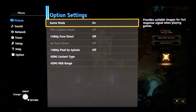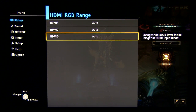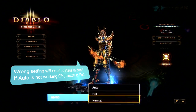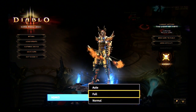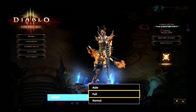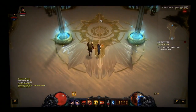Game mode is turned on in options settings. And what's important when you connect a PC or play games on PlayStation 3 or 4 — be sure not to select normal because normal will crush details in black. We are talking about 0 to 255 range for PC and PlayStation games, so either auto or full. For movies, normal. And screen settings — 16x9 overscan is disabled so that you get the best possible sharpness, upscaled with Panasonic's scaling technology.